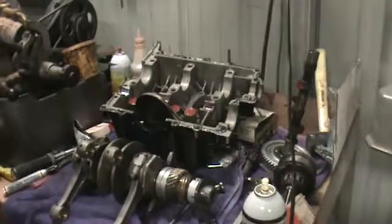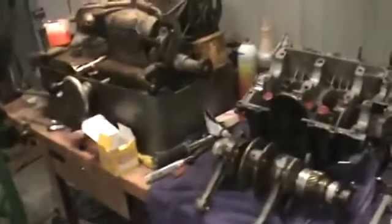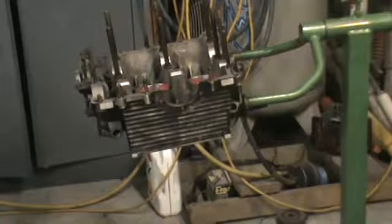We got our lifters in place, we have our lifter clips in place, we have our one main bearing off to the side so we can make sure our crank's in properly. I'll zoom that in and go ahead and drop the assembly in next. As my foot gets unhooked off that tranny case. There we go.